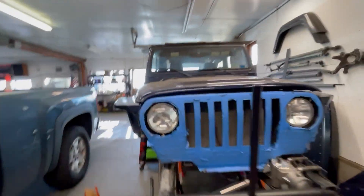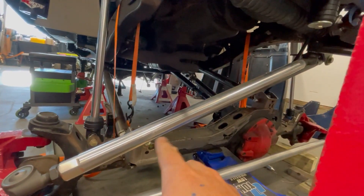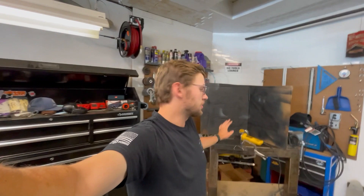Ways around this: the easy way would be to go to the passenger side and then only have to worry about dealing with the exhaust, which seems to work in most cases relatively easy, and you have plenty of room over there to do whatever kind of triangulation you can fit. But on paper, the upper arm has more control when it's above the diff, so I think I can pull it off. By doing what I'm doing here, I'm saving over an inch as far as offset off the inside of the frame.